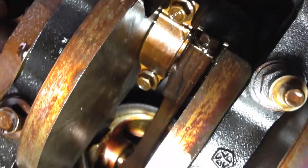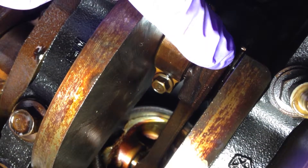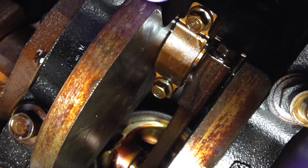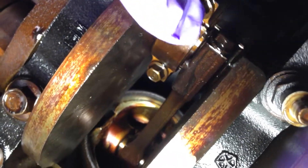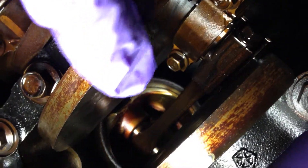Here are two rod ends, and this is the bad one. You can see it's darker in color than the good one. There are two bolts on the bottom of the rod cap — on the bad one, it's dark. You can see the rod going up to the bottom of the piston up there.